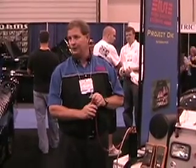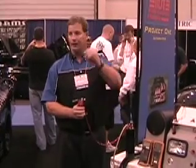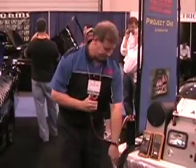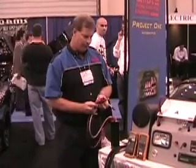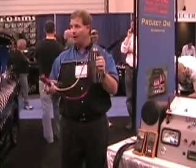You know the reason they have the little resistors? They say charge the cap with that resistor in place so your terminals don't look like mine - see how they're all burnt? But we're going to charge this cap up real quick. 12 volts, fully charged. It's 12 volts.